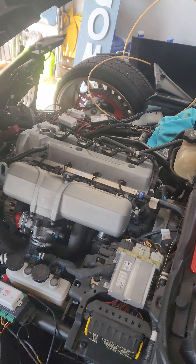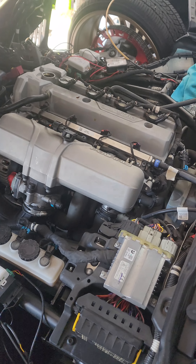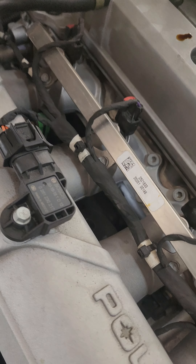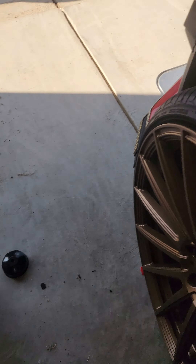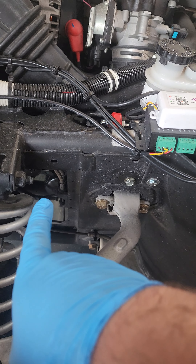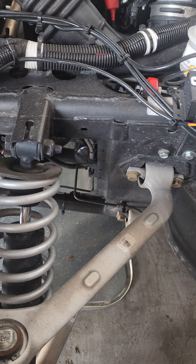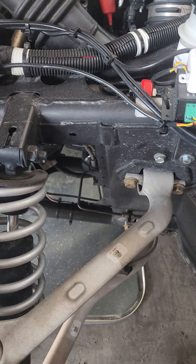My oil level was low, so I didn't have as much as I thought in there. I just finished sucking all of the oil out of the dipstick area. Now what I'm going to do is go down where the oil filter is and be very careful loosening it. If you don't have an oil drip pan, you may want to put some cardboard down, because when you take out that oil filter there is going to be some oil that drops out — regardless of how much you already extracted. So I'm going to put that breaker bar together and take off the oil filter.